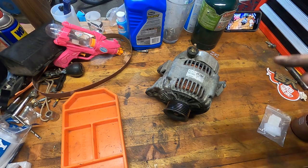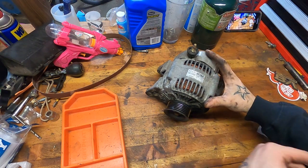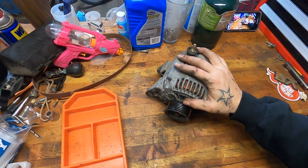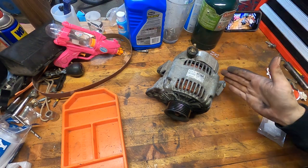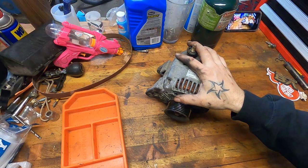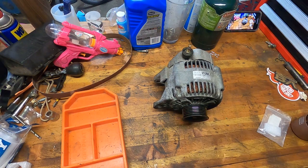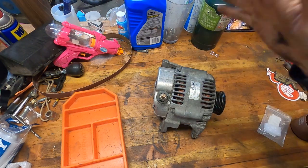What is up? I am Doug with D&E in the Garage. This is a 136-amp alternator out of a Jeep Grand Cherokee with the 4.7-liter V8. In our last video, we went over how to upgrade this on any Jeep, Dodge, Chrysler 4.7 — we upgraded from a 136 to a 160-amp. For me, that was because I run a winch-mounted snowplow, but you may be doing it for off-road lights, an off-road winch, or maybe you run a coffee maker in the back every morning.